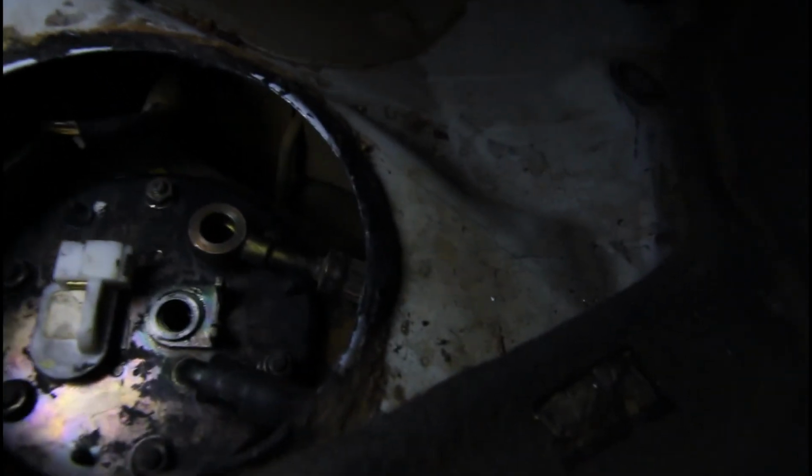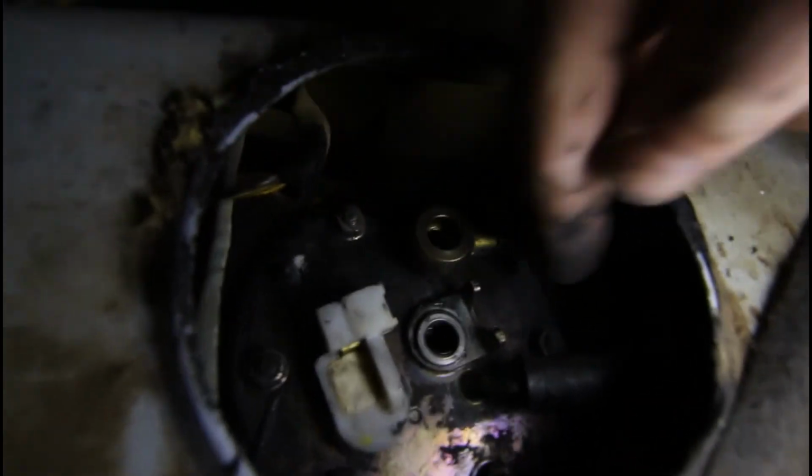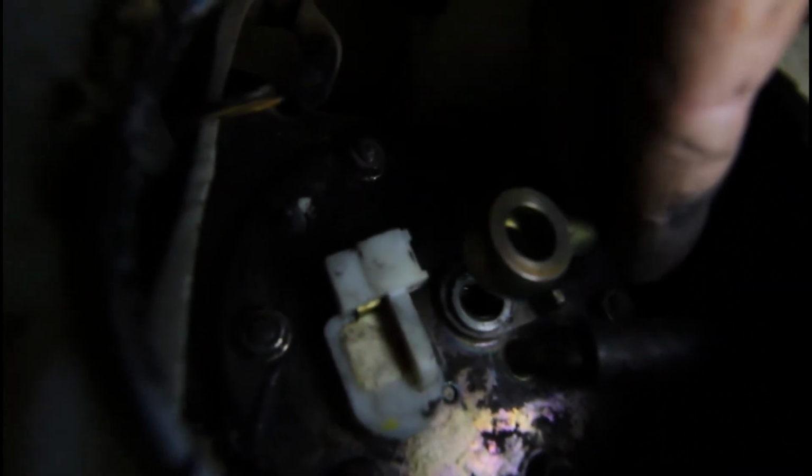So I've got the washer sitting back on this hose connection here, and then we sit that hose bit on. Don't know if I can get enough light in there to see this. Probably not. Talk about the worst position. That might work. So put our washer on here, then the hose sits across and goes between a couple of bits that hold it in place, and of course the bolt has a washer on it already. Make sure that's in place. Make sure you get everything in line, and then you can start threading.